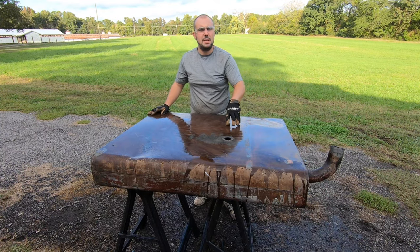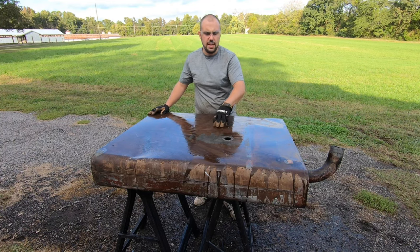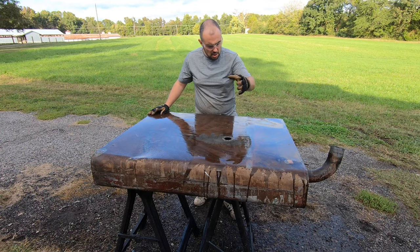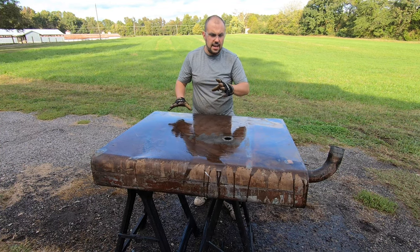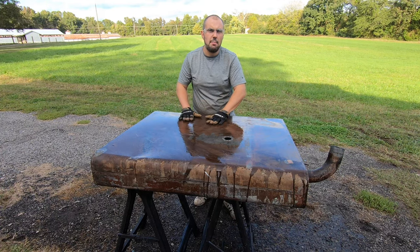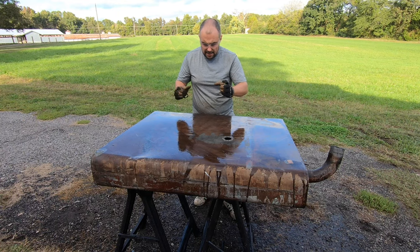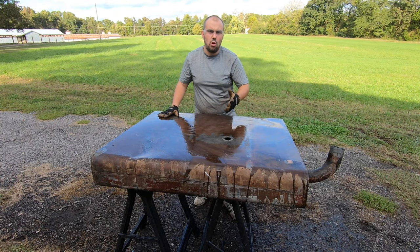So some of these steps may seem counterintuitive, as in you've gone to all this effort to get rid of the rust and degrease it and then you just keep filling it back up with water. But these are just the steps that POR-15 recommend. You've got to get it cleaned out inside so that when you put the sealer in, it's just got bare dry metal to attach to. And if there is some flash surface rust there, it's not an issue. The coating will cover it.